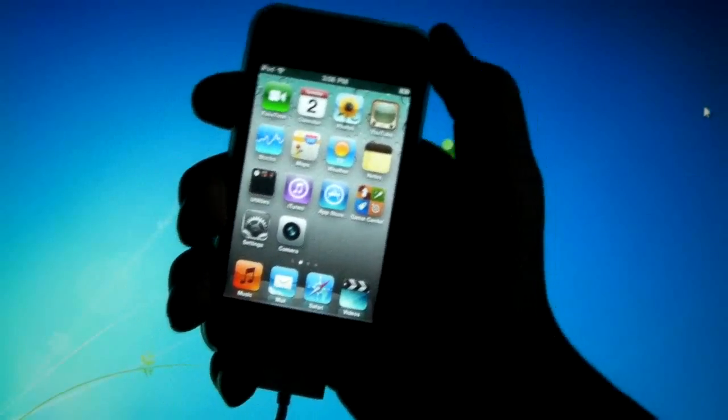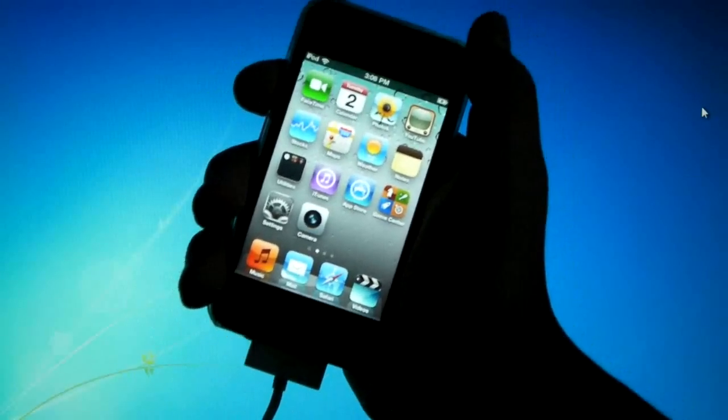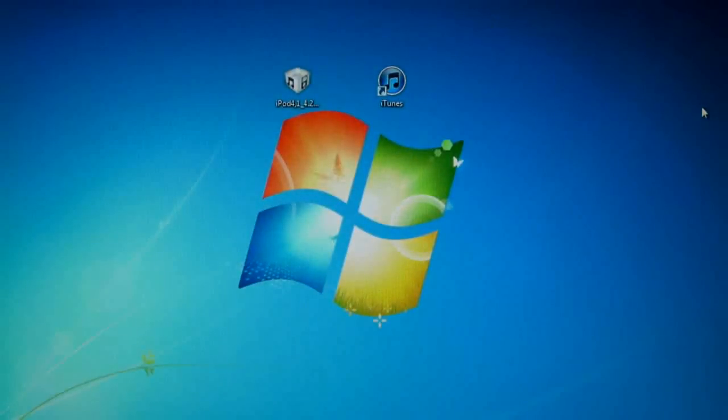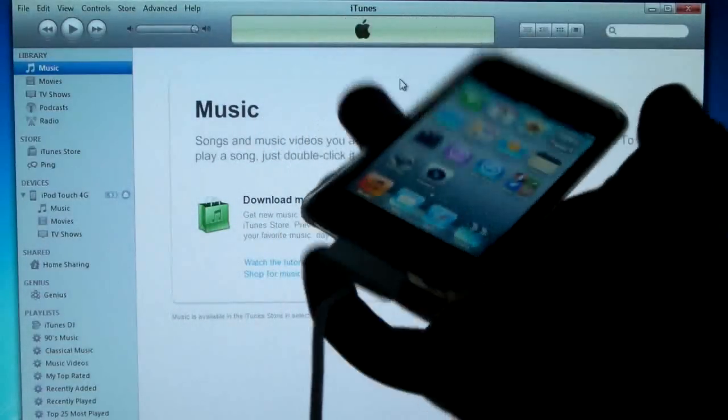There's no jailbreak as of now, but if you want to take the plunge and check out the features, we're going to do that right now. You'll need a couple things: you'll need to download iTunes 10, otherwise it will not be able to sync with the iOS 4.2 device, and you'll need the 4.2 software for your device of course. All the links are in the description below. Go ahead and open up iTunes and make sure your iPod is plugged in via USB.